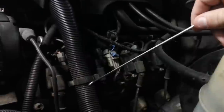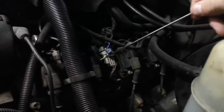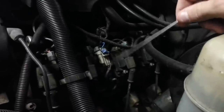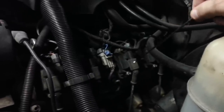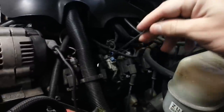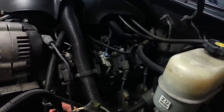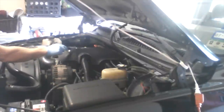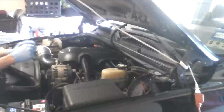And you can hear it's not too bad right now that it's warmed up. But trust me, there is a little bit of knocking, and you'll know when you have it, you can hear it pretty good. It sounds maybe like a diesel engine or a pinging sound. So let's go ahead and start taking this all apart, and it's pretty easy, and then I'll show that process. Start by removing your top shroud or cover here. It's just an 8mm socket.